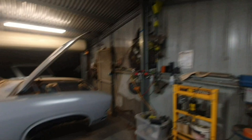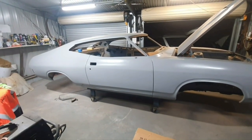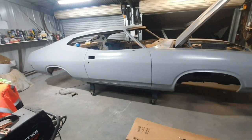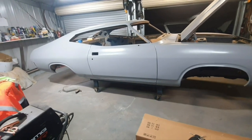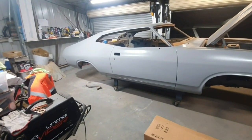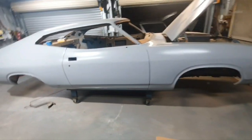It's Friday now, it's going to be raining all weekend they reckon. Tomorrow's going to be really bad, so I'm going to have to reverse what I spent three hours doing on my last day off. Because it's too wet, all I can really do is sand, but I don't want to go sand the whole car down. I could take the doors off, the guards off, all that stuff. But I really like having this car back together like this — I just like looking at it. But what I'll do tomorrow, I'll have to put the car back on the rotisserie, flip it on the side, get sandpaper, scuff up all the epoxy under the car, and put this Raptor on.